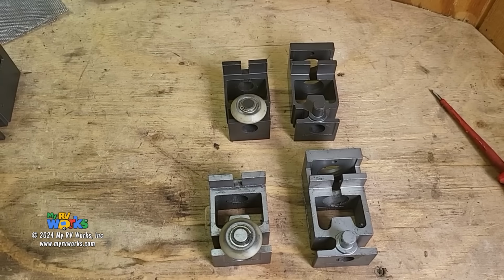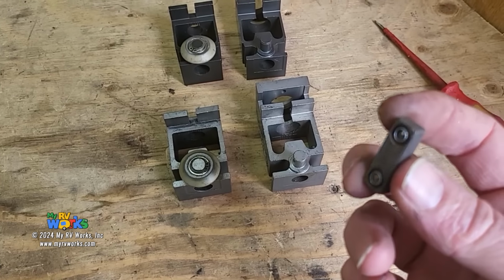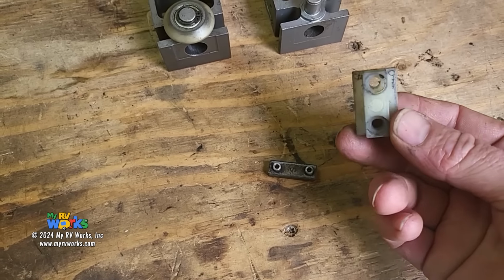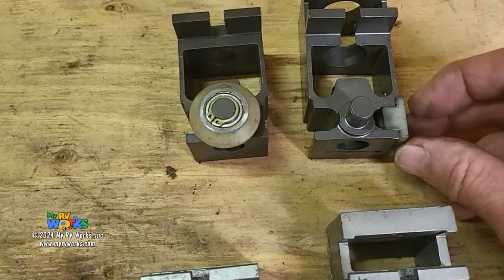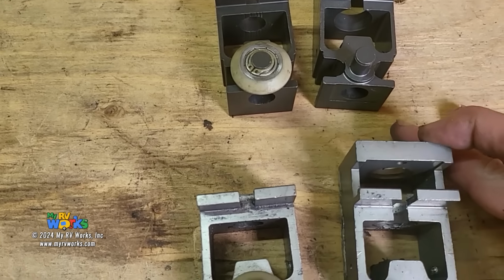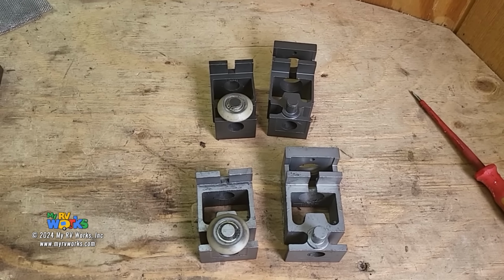But there's more. For the next part of our show and tell, I want to talk about the gibs. Remember, we just talked about those, the gib that the thing slides in. So here, they have two types. They have a plastic poly type of gib, and then they have a steel gib. Okay, so they've come out with the type that it slides in on plastic. But when they did that, it does not fit into these, okay? So we have to have the steel gib, which fits into that. But if you take the steel gib and apply it to here, there's too much play, okay? So we've talked about the direction of the fin points and now the diameter of the gib slots. So that's another difference that they have made on these bearing blocks. But there's more.